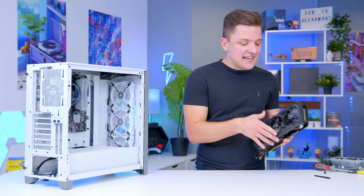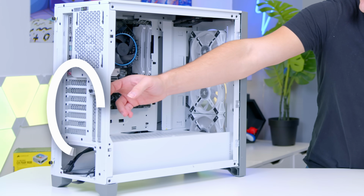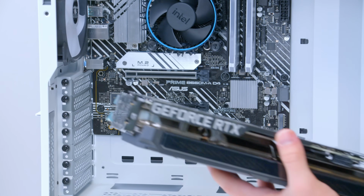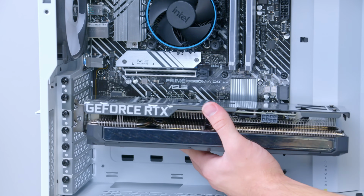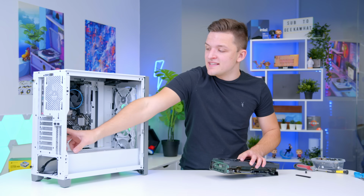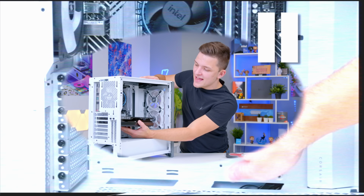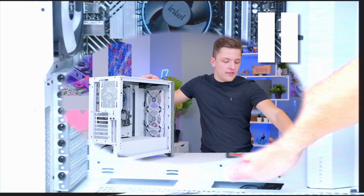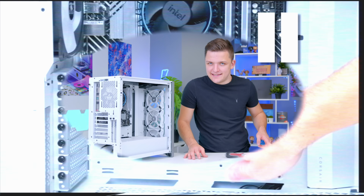Now in our chassis today, we need to remove a couple of PCIe covers. These are the little metal covers that go to the left of the motherboard. To find out which ones, hover the GPU over your slot. You can see here why we needed such a large case, and then go ahead and remove the second and third slot covers. I've only gone and got the wrong slots, haven't I? It's actually the top two, not the second and the third. Let's rewind that back again, pretend those slots were never out, and then try and insert the graphics card.